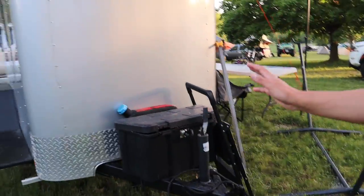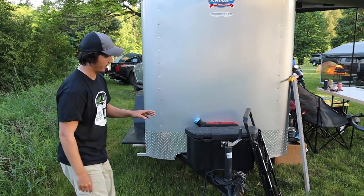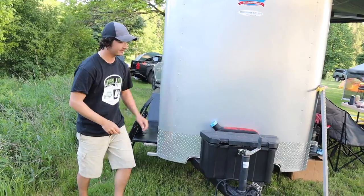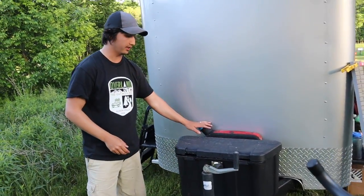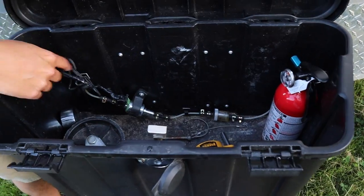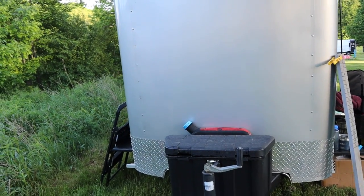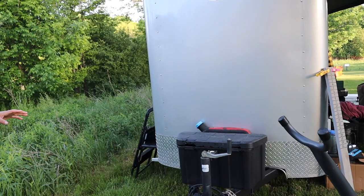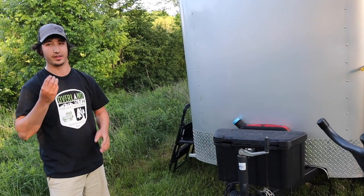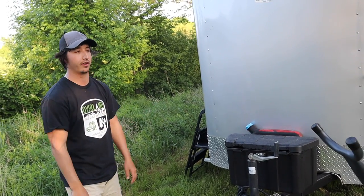The front here is where I have the diesel setup. You can see the diesel fuel tank, and that's plumbed through a fuel filter and then the fuel pump, and back down into the unit itself. Underneath the trailer there's the exhaust that comes out there — it's all hidden and easy to work on, out of the way. And if you know something about diesel heaters, the pump is really annoying because it clicks. So having it outside and out of the way means it's out of mind and you don't have to listen to it.